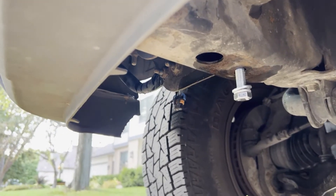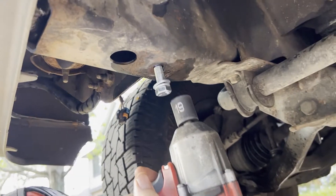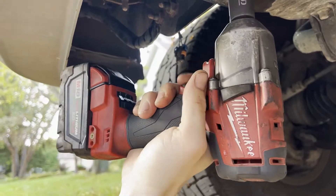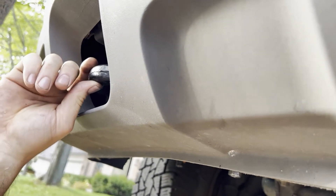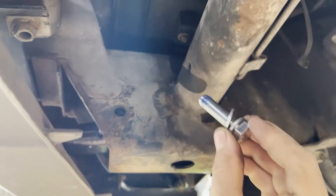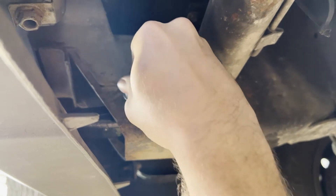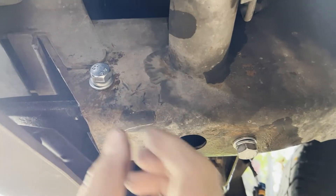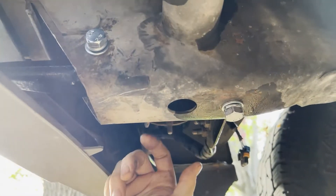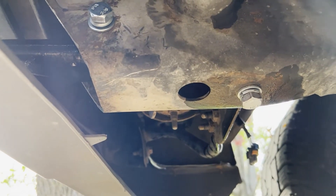Under the truck now — the bottom bolt is started. This takes a 19mm or three-quarter socket, so I'll go ahead and cinch it up a little with the impact to save time, but I'm not going to tighten it all the way yet, as I want to still be able to move it to get the side holes lined up. I've got the 45mm long one and I'm coming in from the side — I have to lift up on it just a bit to get it started, which is why I left the other one loose.